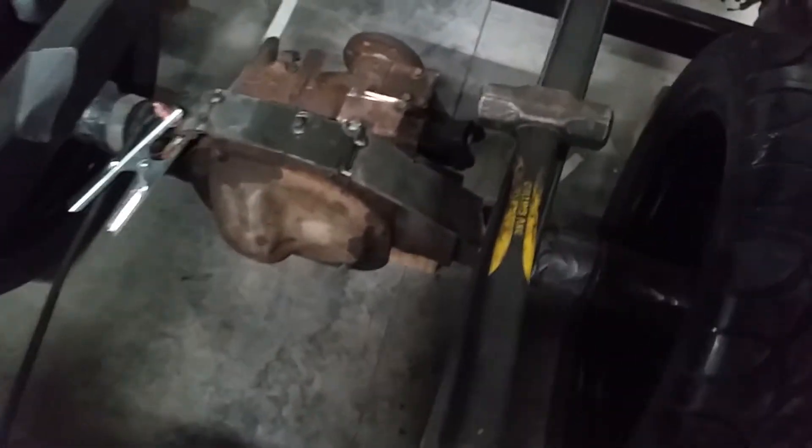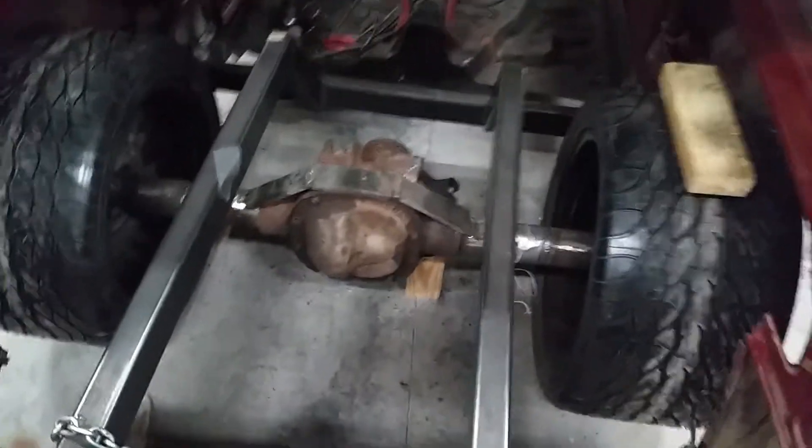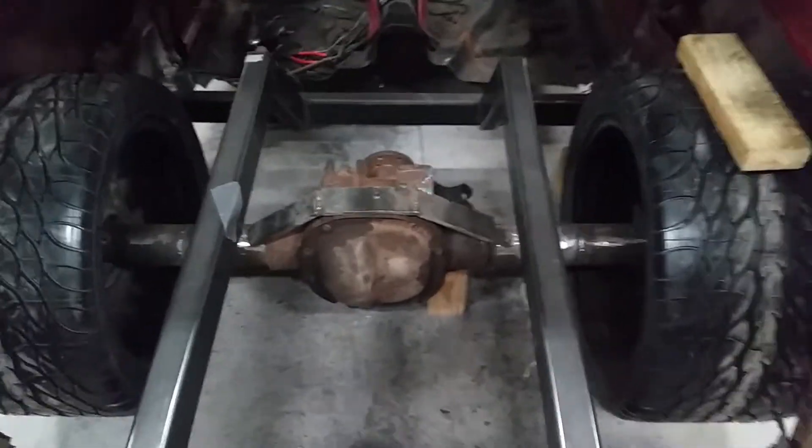This is what we've come up with so far - we've got the top plate tacked and we've built this outrigger here that bolts into those factory bolt holes on the rear end. We'll be trimming that corner so it doesn't look so goofy, but going to take it off and weld it all up. This is finished for now because it's getting late and cold in the shop. Got all the spots where we scored it to bend it welded up solid, got this little ear folded over, three bolts in the front - we will be cleaning up those corners.